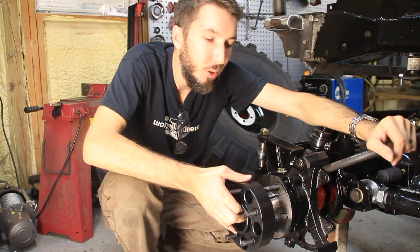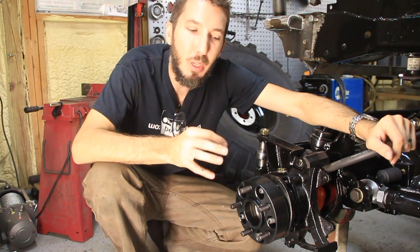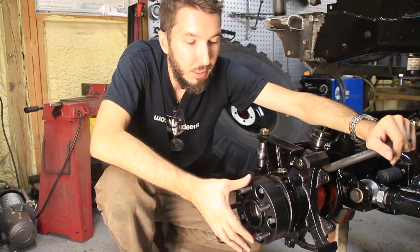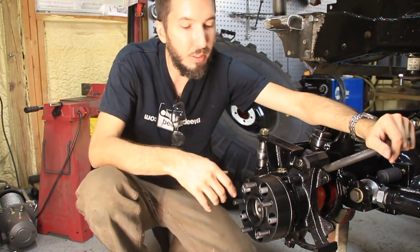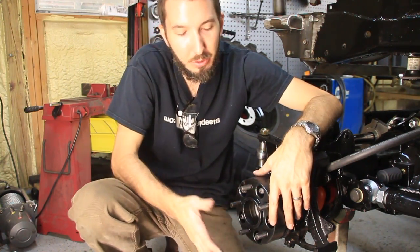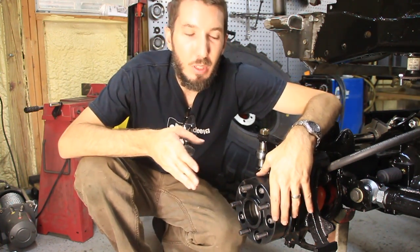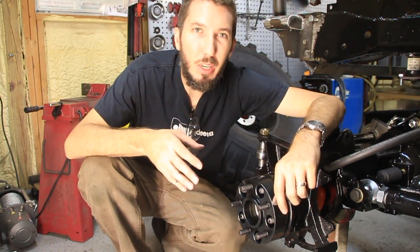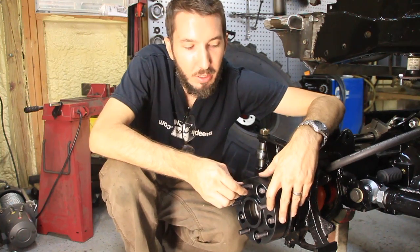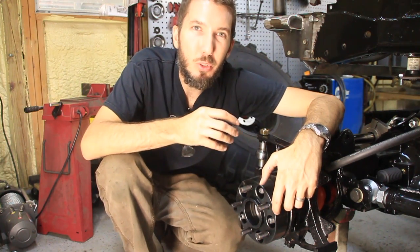You can go ahead and put your wheel spacers on. If you've got aluminum wheels, those are usually thicker — if you're going from steel wheels to aluminum, you might need longer studs. One thing to consider is that you don't want your studs sticking out past your wheel spacers, because your wheel still has to go on. You can't get studs in every length, but you can get them long and then cut them down. When I do that, I cut them down and then bevel the edges with a grinder so it makes more of a point, so that when you go to put a lug nut on, it'll straighten right on.